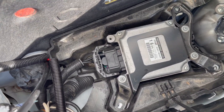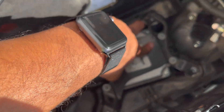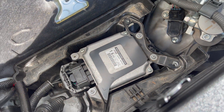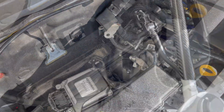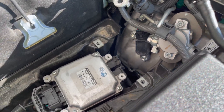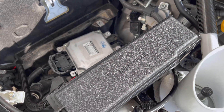Once you remove those, there are additional Phillips screws — got to remove one, two, three — and that should give me clearance to get to this bolt that needs to be replaced. Now that all of those bolts are removed, this plate right here is easily removable. You do not need to remove that module right there or disconnect anything.